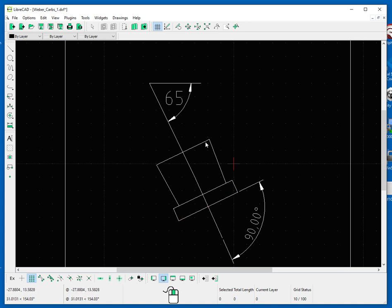So that's the inlet manifold. They're just slightly bigger at the top than they are at the bottom because, like I say, this is oval at the bottom. It's like an oval shape, whereas at the top are round because obviously that's where your rubbers sit on. And I've worked it out that it's 65 degrees, so that the slope on the cylinder head where the manifold bolts to is 65 degrees to horizontal.